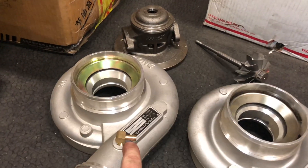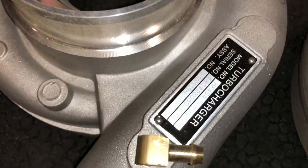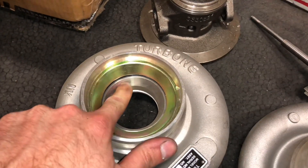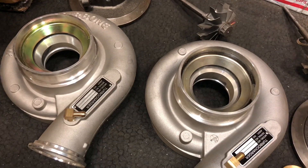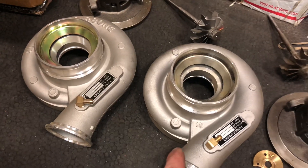So let's go over the fake ones first. This one claims to be an HX40, but it's not. The only thing different about this one compared to this one is that this bevel is bigger. The wheel size is the same size as the factory HX35 compressor wheel — I think these are 54 millimeter compressor wheels.